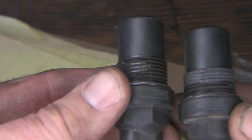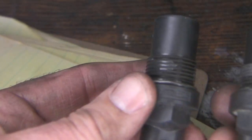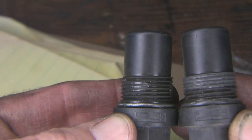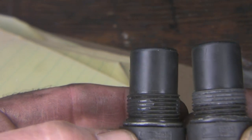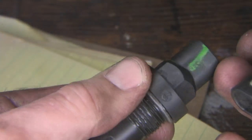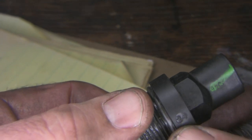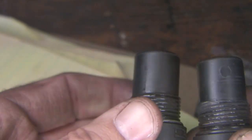I've got you looking through the magnifier. This is the bad sensor — the one I think is bad for the front — and this is the rear, which is good. I believe these are both identical. They've both got 22512 inscribed on the side there. They have identical length and identical thread, and basically the markings are identical. The only difference is this one has a 2.4 right there, and this one has a 1.9 — presumably the date of manufacture.